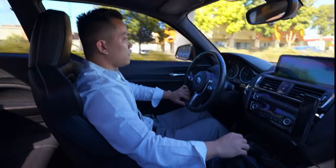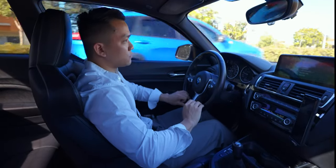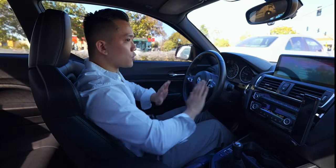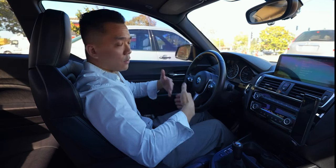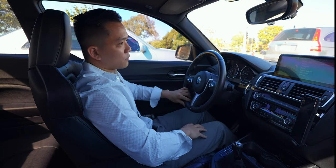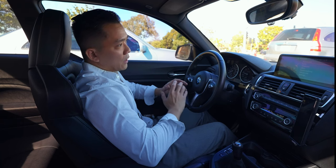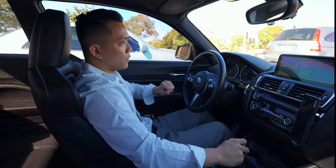You really feel as if you have to hold the clutch in that friction zone as you let on the gas in order to push through that bit of resistance. But because we already have a decent amount of momentum going when we're in second and then transition to third, we don't feel it as much. So there's not as much of a balancing act or resistance going from second to third under acceleration, but this also applies under incline and decline.